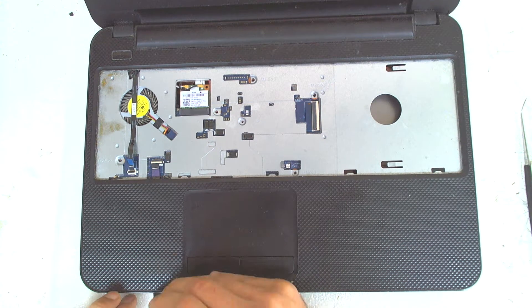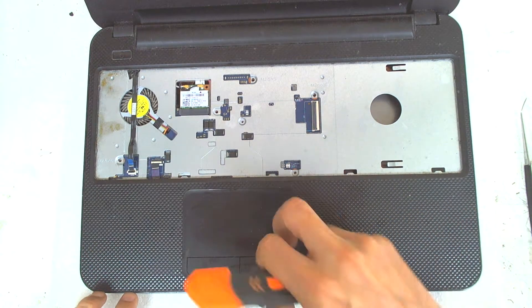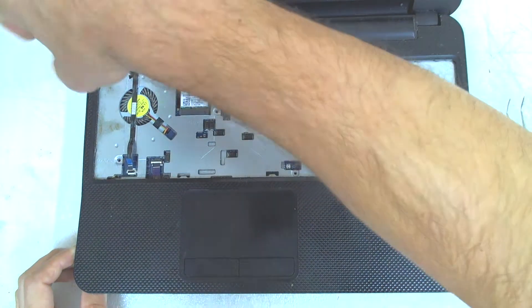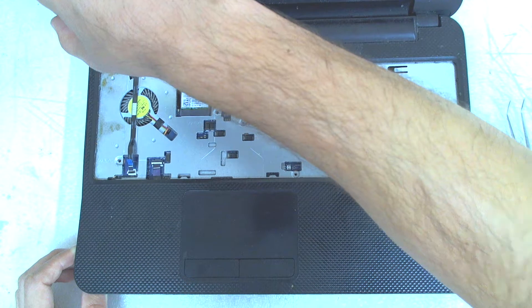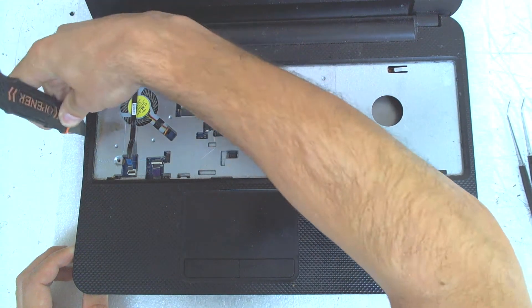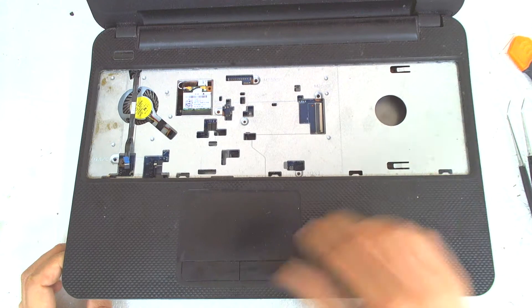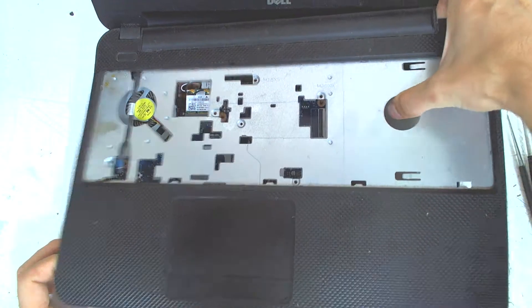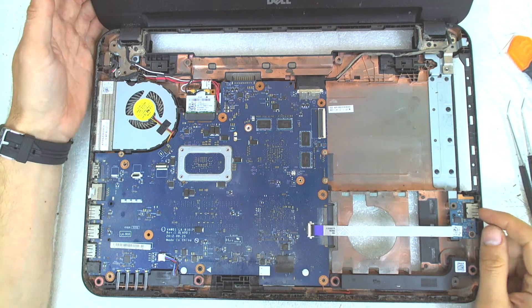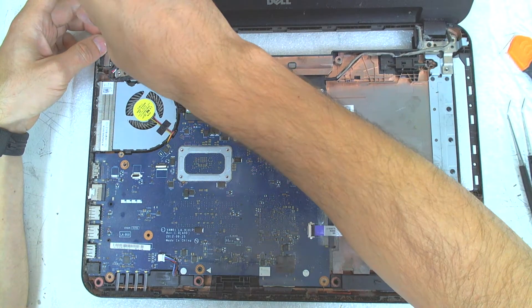Like this, gently. After that continue to the other side and just lift it. We have one more screw here right next to the cable — sorry, I don't see it. Just lift everything up and the board is up front. Before all, tighten the screws on the hinges because with time they are getting loose and this can cause damage to them.